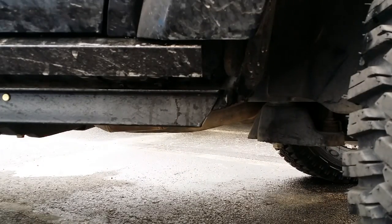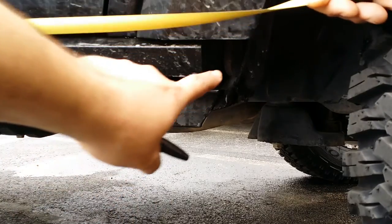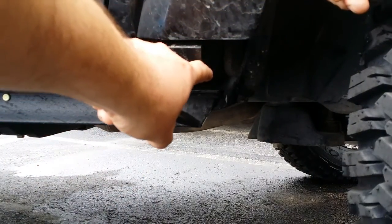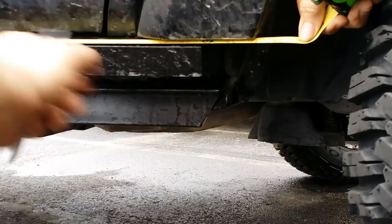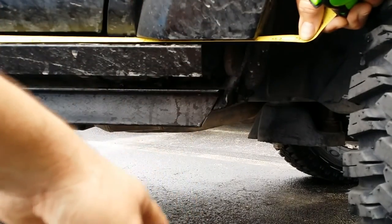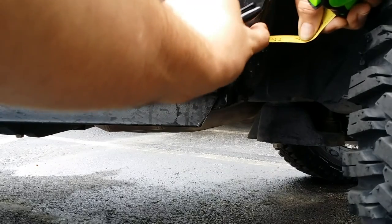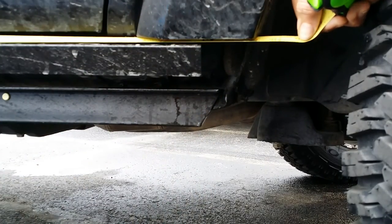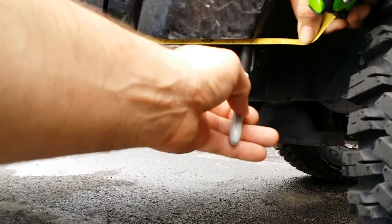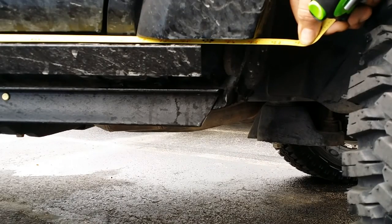Now, remember when I said I would have purchased a little more metal if I were to redo this? This is why. 7 feet only gets to right here after you bevel that in on the long. If I were to redo it, I could make it 74 long to long, and this wouldn't be straight. It'd come to there and be flush with the trim, unless you're gonna do like some of those guys who like to trim that off. I guess maybe I can do that later, because I'm really not gonna redo this just for 2 more inches. But 74 inches long to long, 30-degree bevels. That's it for the overall length.